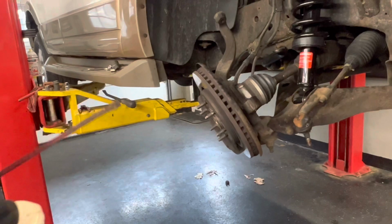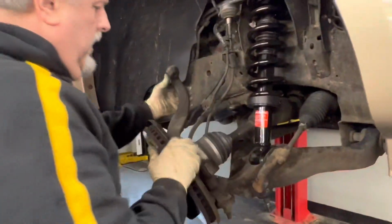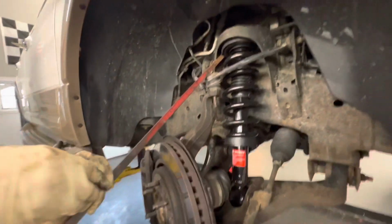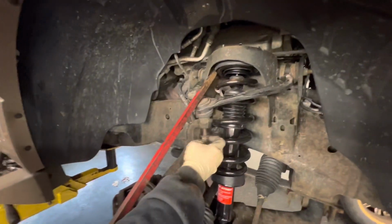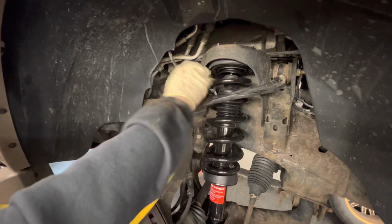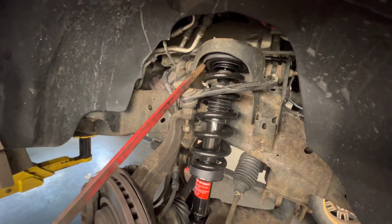Now we've got to get our front lined up here with the tie rod in here. Okay, we're going to catch our 21mm nut. Trying not to pry on the strut. I'm on the side of it. Tony's holding the bar, and I'm going to zip this thing up with the gun right now. Don't spin.